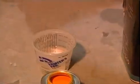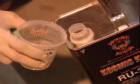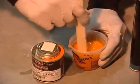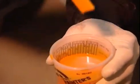As far as the ratios for mixing the candies, for this particular graphic, I like to play with the ratios a little bit. It should be 2 parts binder to 1 part candy, but I like my candy a little more intense, so I'll put more candy in there than normal. And this is about the viscosity that I want, with that intensity.